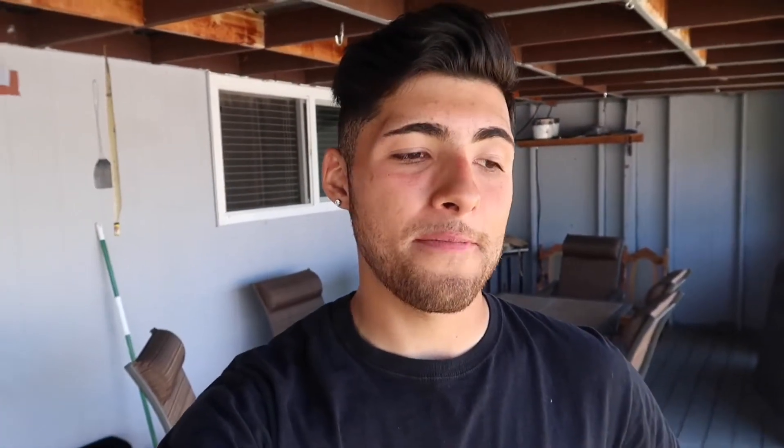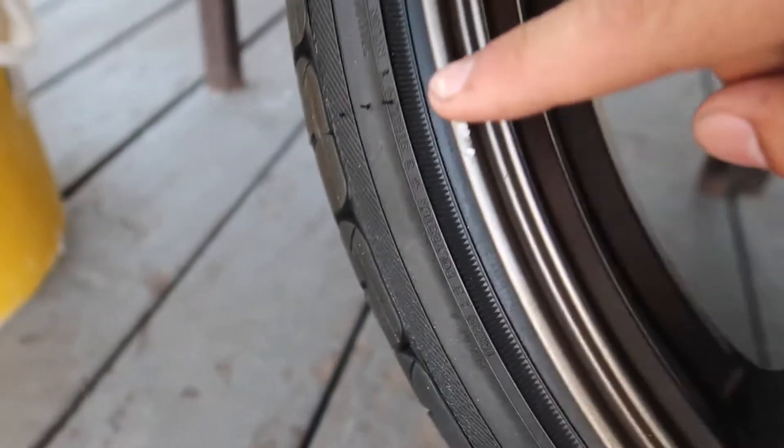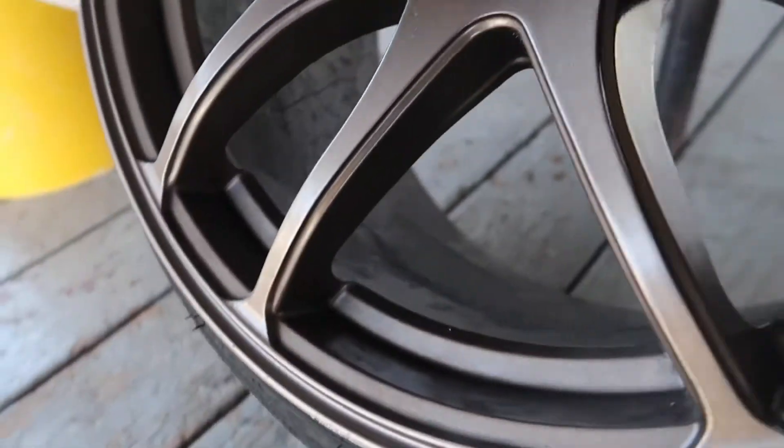I can't mentally have the state of being that I have curb rash wheels. You could probably see it under the paint, but I'm gonna try my best to even it out with sandpaper. There you go — there's one side. The good thing is it's not too deep, so if I sand it with 600 grit sandpaper it should be fine, even a 1200. It's not super bad, but I'm a picky person and I personally can't go around rocking that.